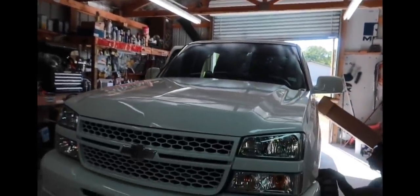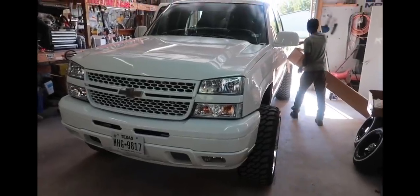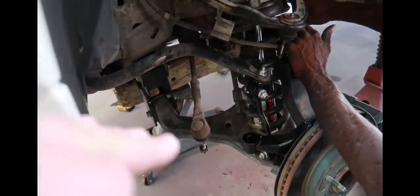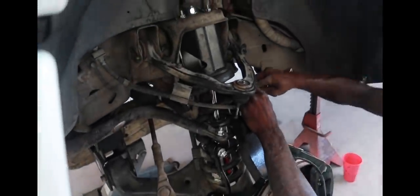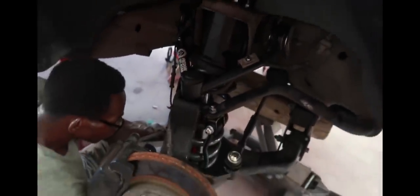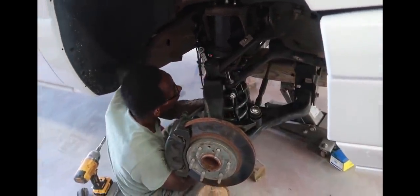Here's the truck — it's turning out to be pretty cool, got new headlights and all that. Keith is working on the springs, trying to get the springs out. Got all the ball joints done. Had to run to the auto parts store and get some tie rod ends because they were worn out — Keith suggested replacing those, they looked pretty bad. Getting down to the final step here — Keith's getting the shocks back in.